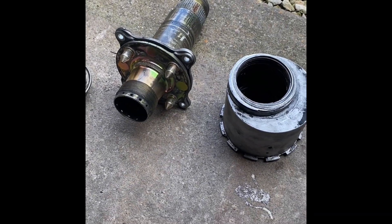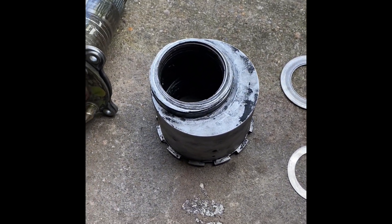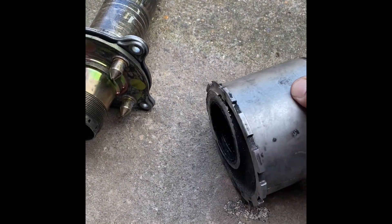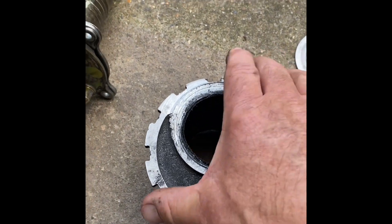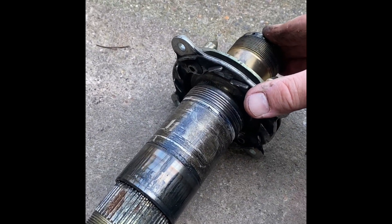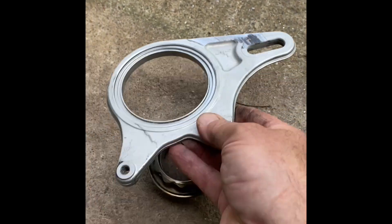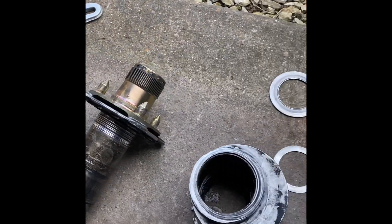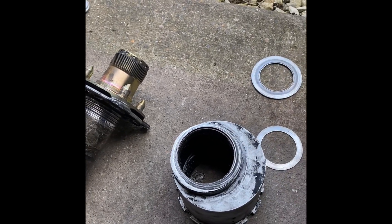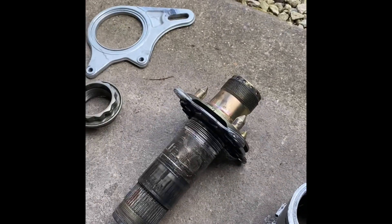This is a 2007 F4000R where the hub has decided to let go — or rather the bearing inside decided to let go. As you can see, it's caused a massive amount of damage to the hub, inside and out, and also to the axle. It certainly shouldn't be looking like that. The other piece of damage was caused to the caliper flange, none of which can be reused. So I'm going to replace it all with a 2010 hub and axle and I'll show you how it's assembled.